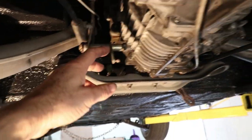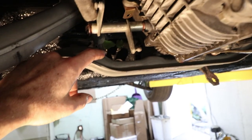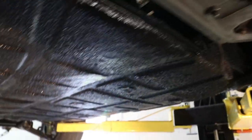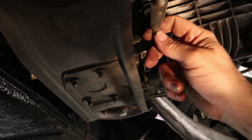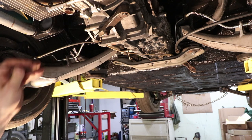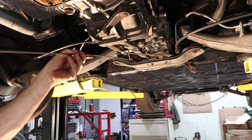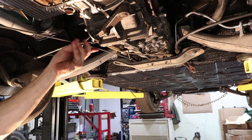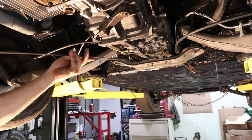Here's the underside of the car and the area we're going to be working with. This is the bell crank that's part of the transaxle — there's a hole right back there; that's where the throttle rod goes. Looking at it from the side, this right here is where the throttle rod goes. So it's really a connection between this pivot and the pivot on the pedal box. I'm hoping to be able to just snake this through there. The transmission doesn't seem to be in the way, but something inside the tunnel is — there we go.